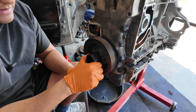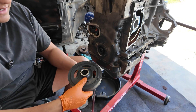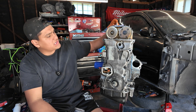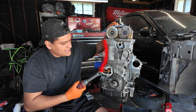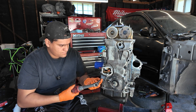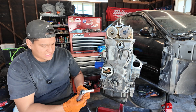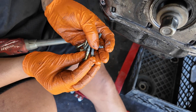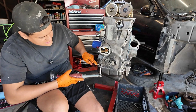As you can see, this just usually pops right out, but it's really stuck on this one. Now I'm going to use the 10mm socket to take off all these bolts. The bottom two bolts on this engine are going to be different than the rest — this one has like a shoulder, and these really don't. They're just regular bolts.